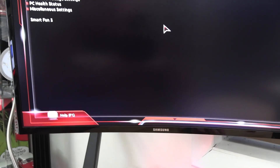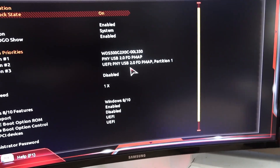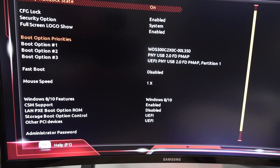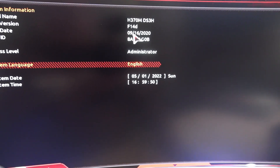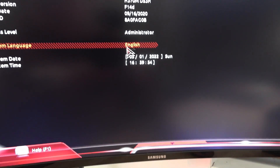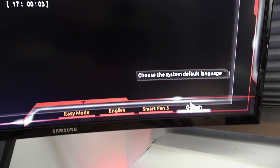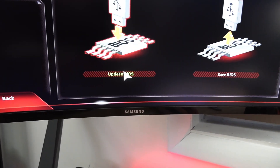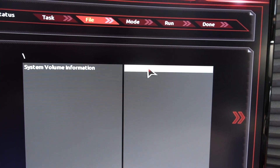Some systems aren't that fast, but I don't have much on this PC. Here is our Gigabyte BIOS. Up here where it says BIOS we can click on that, or we can go to System. We can see F14D here — and we're actually going for F14. Down at the bottom there's a little arrow — we want QFlash, so we can flash the BIOS. Select Update BIOS. You can see our thumb drive is being recognized and it sees the file right here. Go ahead and click on that, then click the arrow to continue.